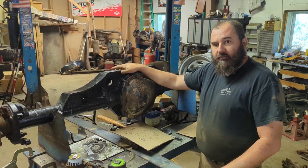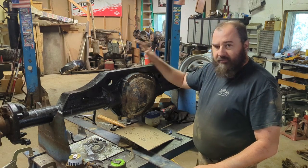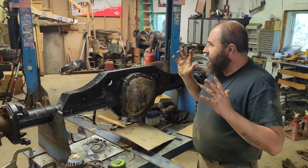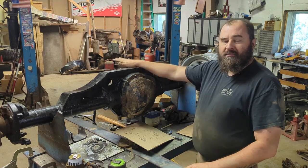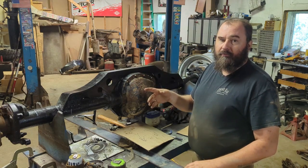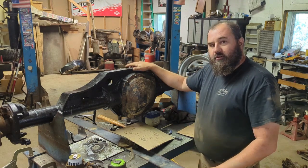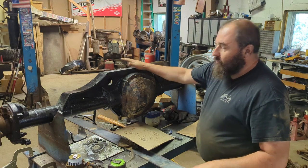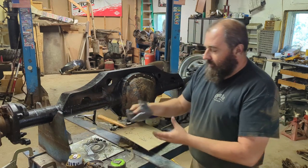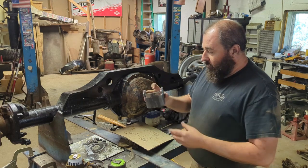So what I'm setting up on my rear axle - I want this to match what I currently have because it works extremely well. Link separation, locations for all of my mounts, everything I want to be the same. I want to unbolt my stock stuff and bolt this thing back in, with the exception of the stretch. I am going to cut off my mounts on the frame, slide them back 10 inches, re-weld them, but all the geometry should stay the same. Doing some planning, I went ahead and cut out some brackets with the plasma cutter - they're not the prettiest thing in the world, but they're gonna work.